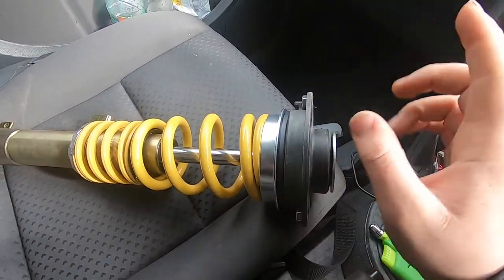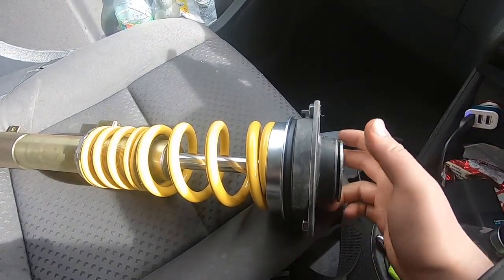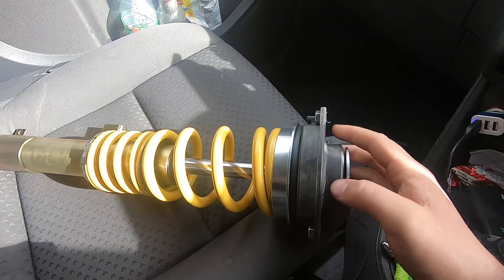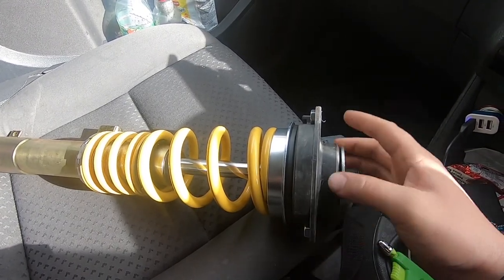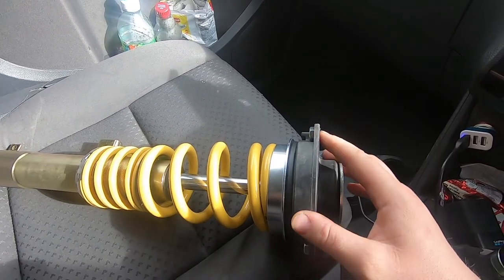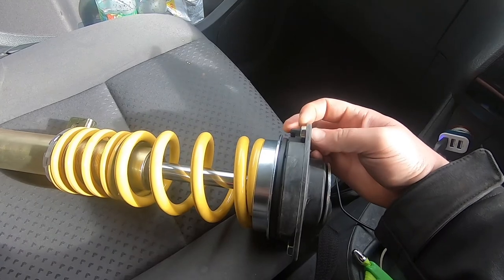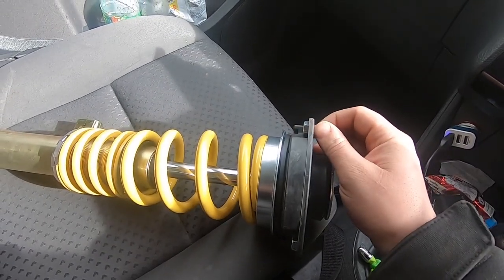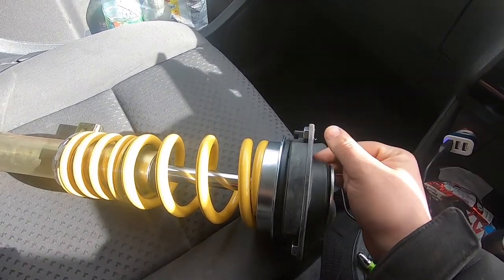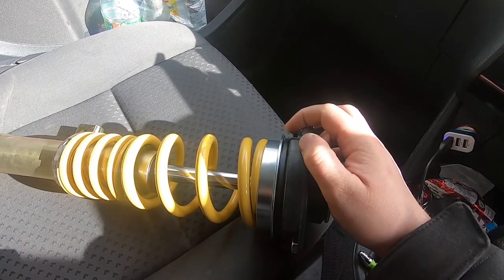Basically, on the old one on the car, I was trying to remove those three bolts to remove the actual leg, and two of them came off easily. The third one was coming off until halfway, and then the nut came loose. So what I've got right now is a bolt that is loose but with a spinning nut on the end.